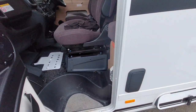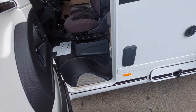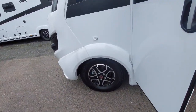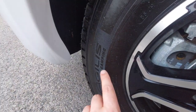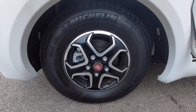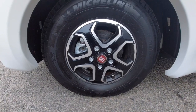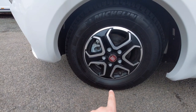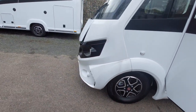It's actually better to refer to the tires themselves for pressure information, because they're specialist motorhome tires which can be pumped up to a higher pressure. You can see on here it's got the camping mark on it. They're actually rated for mud and snow but can be pumped to a higher pressure than a standard tire. The reason for that is they've got reinforced sidewalls, so if they're left for long periods in one position, you don't get a flat spot where it's been sat.